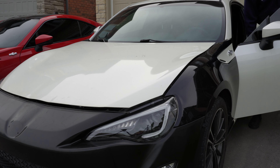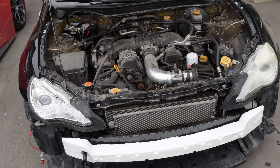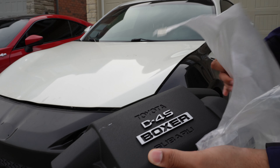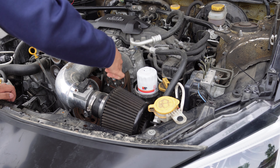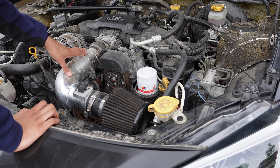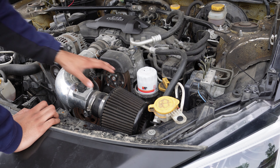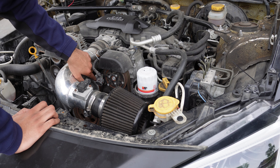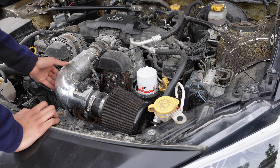Now that we've made significant progress on both cars, there's one more thing left to do — getting started underneath the engine bay. This engine bay is super dirty and we're going to detail it in the next video. Right now there are two issues to take care of. First, the engine bay is missing the appearance cover, which you can see on screen — we're going to throw that onto the car. Second, there's an issue with the intake: the cold air intake the previous owner installed is a very cheap one, and it's slowly dropping down and hitting the pulley on the bottom. That's not great for the car and could cause damage in the future, so I definitely want to take this out and replace it.